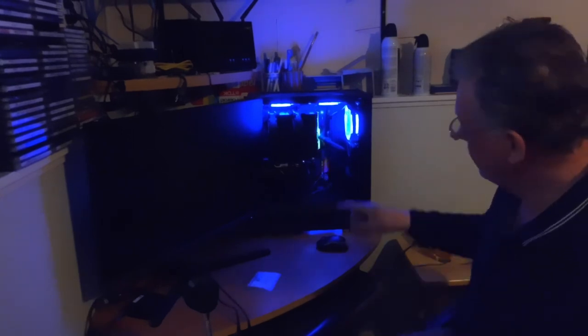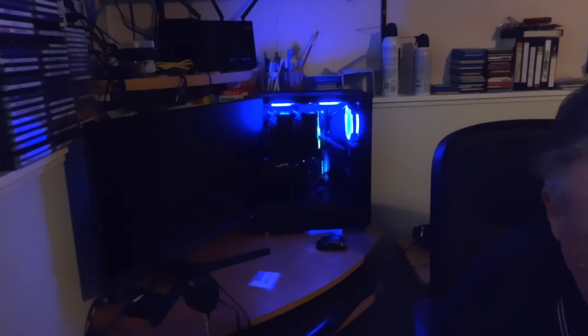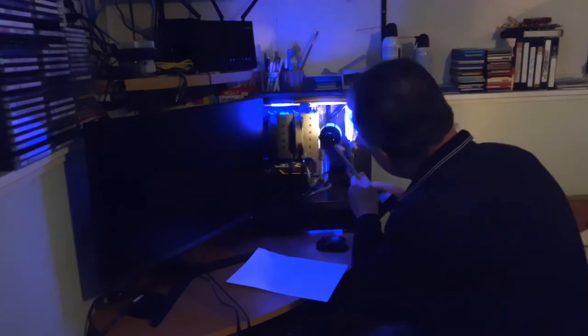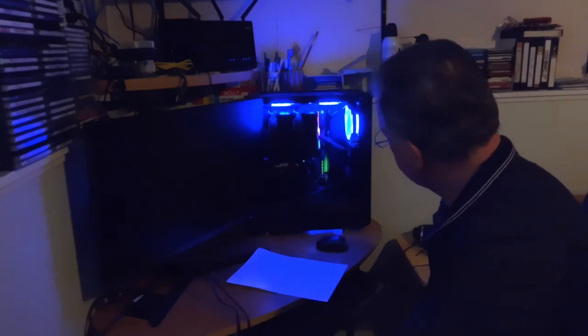So, one of these cards has the thing for the lights. The green light is on. So I need to know what the green light means. What do you mean? One of these sheets that I printed. Oh, okay. Well, you got a bunch of them. This one. Okay. Boot is yellow-green, VGA is white, CPU is red, DRAM is yellow. And that is... It looks green. That's the one at the top. That's the green one. So the boot is yellow-green.